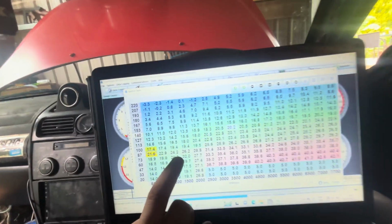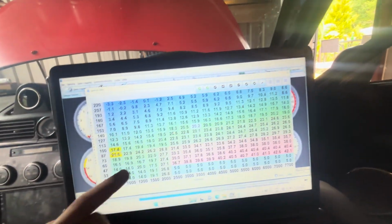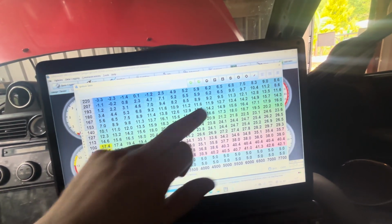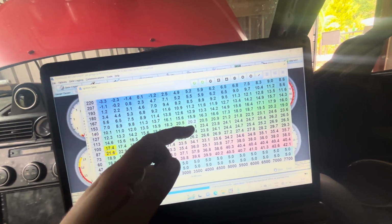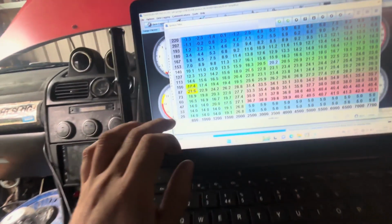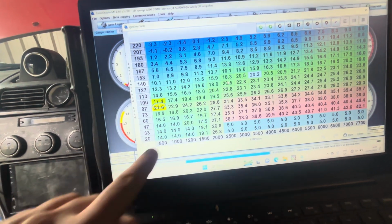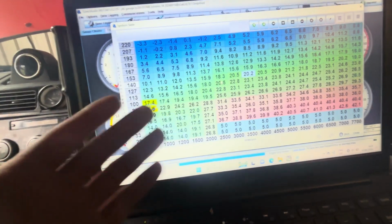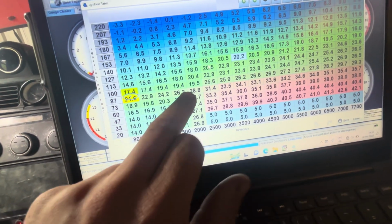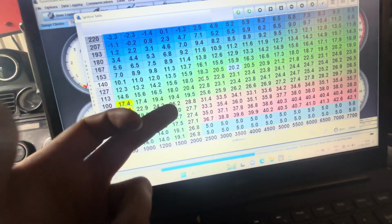So we have ignition timing. This is basically we want to retard the ignition into boost. So we have peak pressure after top dead center. So if you had an NA ECU with a fuel cut defender, I think it still fuels as if it was in this section here. I actually don't know. You have 26 degrees of, or 19 degrees of timing, let's say. I don't know if that's right, but here we go.